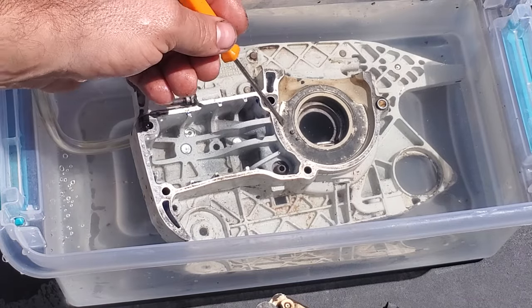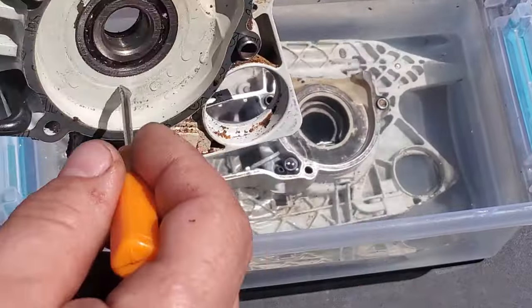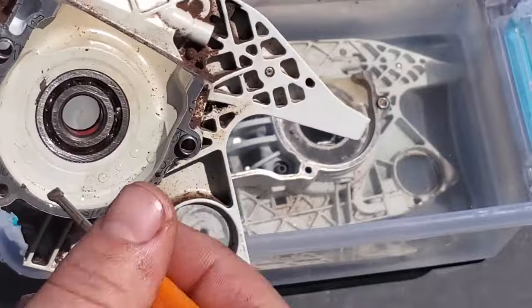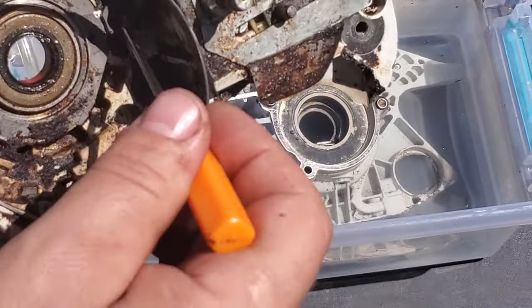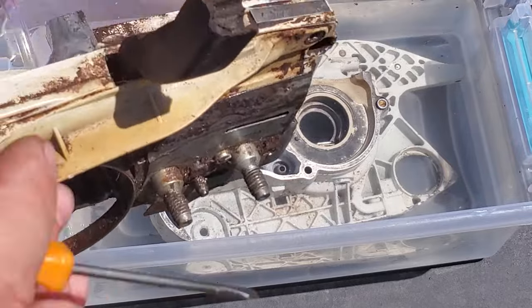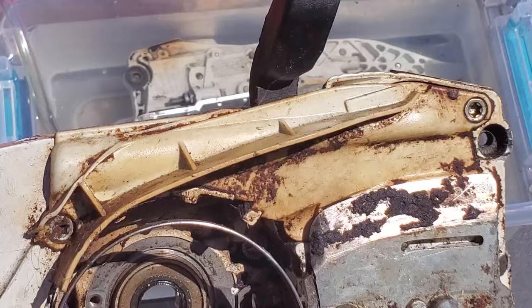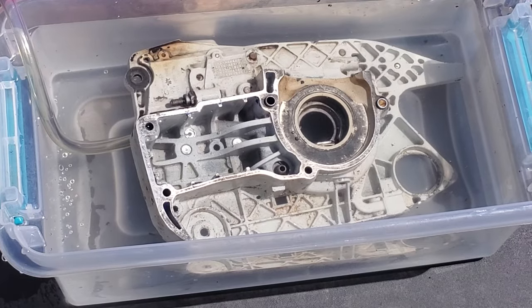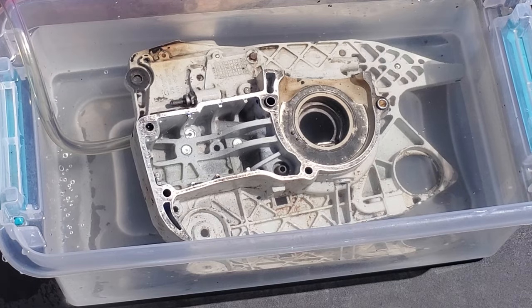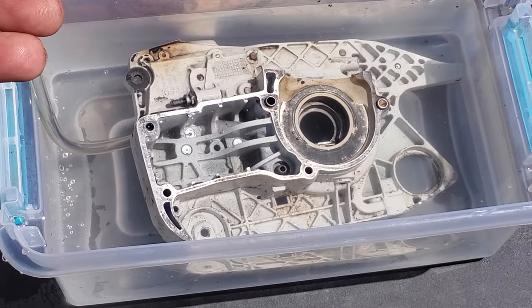What do you think neighbors - any suggestions to fix that besides JB Weld and epoxy? I can't put JB Weld or epoxy on the surface right here because my counterweight would break it off or it would flake off and then seek, kill and destroy my top end. I also can't JB Weld inside the oil channel because it'll restrict oil flow. I thought about putting the saw back together and dropping some JB Weld down in that hole and vacuum pressuring the hell out of it to pull it through the micro crack - that might work but I don't have time. Please comment, share, subscribe - your support is keeping me encouraged.